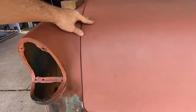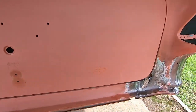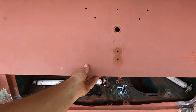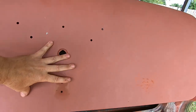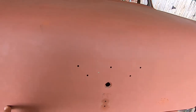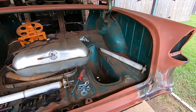One thing you'll notice right away on this car is see how close that deck lid is right there and then how far away it is over here — it's almost touching right there. So what you would do is open the deck lid a little bit and grab it here and use your other hand and grab it here and twist that section that way. Just give it a heave ho and that will get it a lot closer. It's going to take massive tweaking, bending, and prying to get them to fit better.